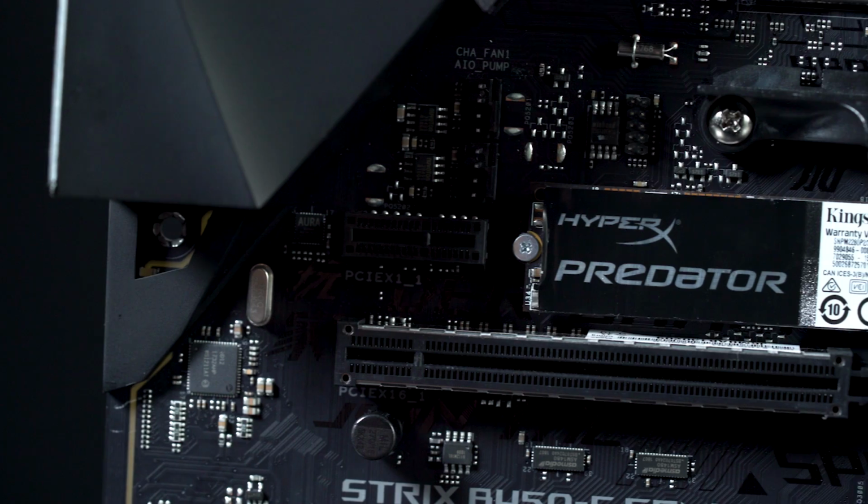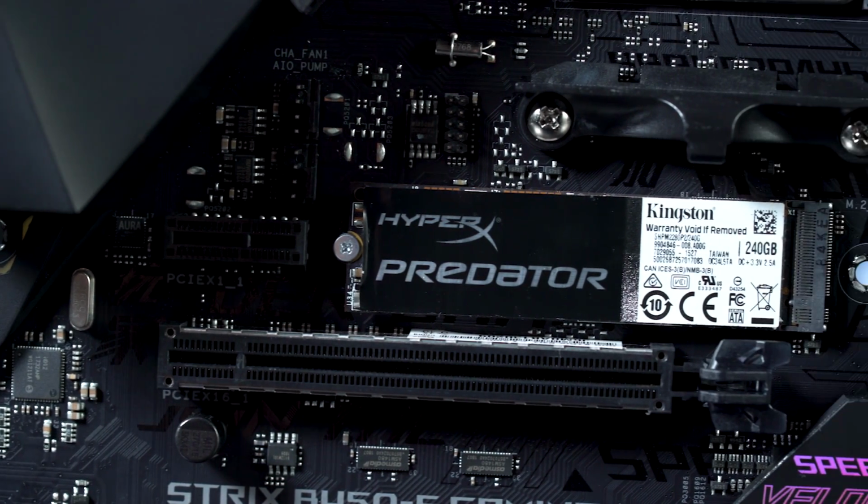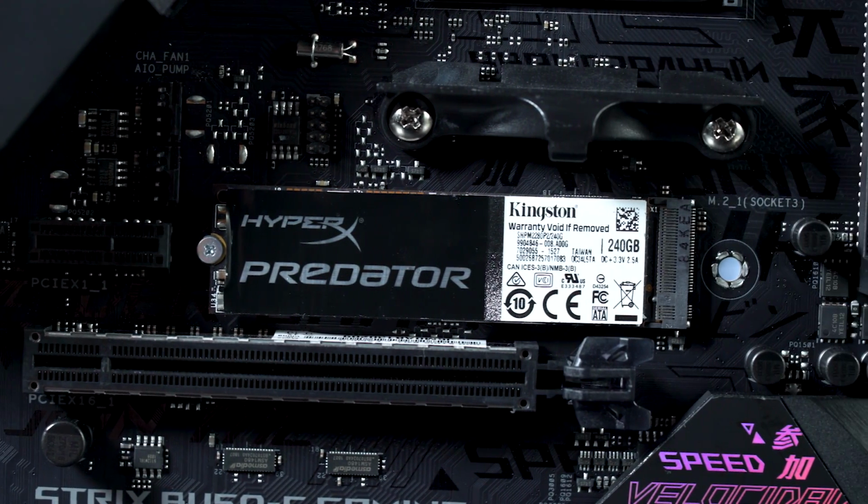You also are going to have dual M.2 based implementations, which is something that's going to be rarer on B450 series motherboards. And we've also set up PCIe lane allocations so that if you're looking to run dual M.2 in a RAID configuration by leveraging CPU lanes for the highest performing NVMe RAID setups, you're going to have that option available to you on this board.